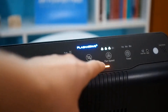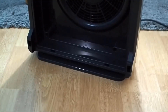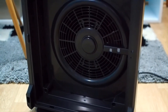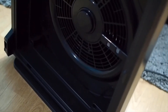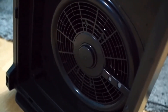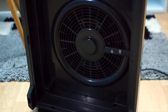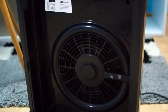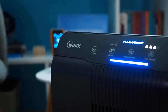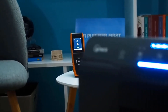There is one substantial competitor to the Winix unit, and that is the Coway Mighty Air Purifier. The Coway normally retails for about $50 more than the Winix, so it is a little more expensive. It has exactly the same output, also comes with a true HEPA filter and a washable pre-filter. However, the Coway — like the Winix 5300-2 — comes equipped with a fibrous filter that is simply coated with carbon, giving it lower gas filtration performance. The Winix 5500-2 also comes with a remote control, while the Coway does not, which may be important to some buyers.